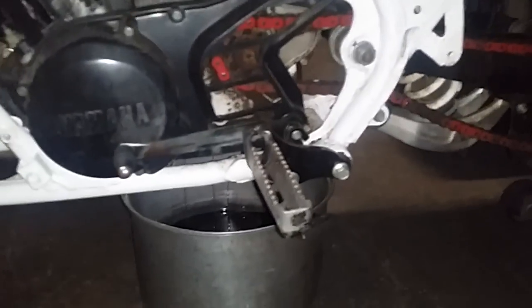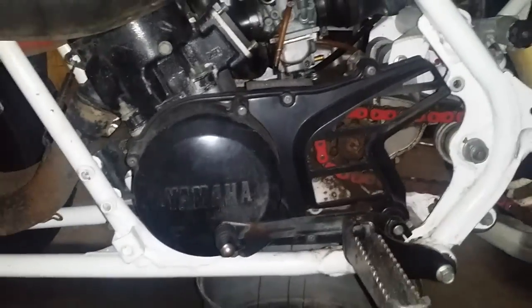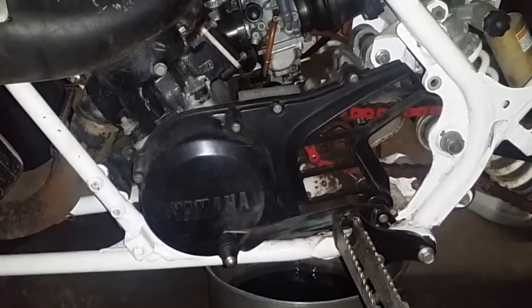Got it jacked up. I'm using my phone right now because I have a light out in my shop and my handheld camera doesn't have a light. It won't come out of gear, it won't shift — I think it'll go as far as first gear, but there's no neutral and once you get to around third gear it quits shifting altogether. At first I thought it was probably just the adjuster bolt loose or out of adjustment, but I can't find neutral at all. I can get it into first but when I go up to where neutral should be I can feel the pawl engage but it doesn't go into neutral, so I'm thinking there's probably more damage in there. Also when we were rolling it from the trailer into the shop with the clutch pulled, the crankshaft was spinning and there was a pretty awful clunk in there like something's broken.